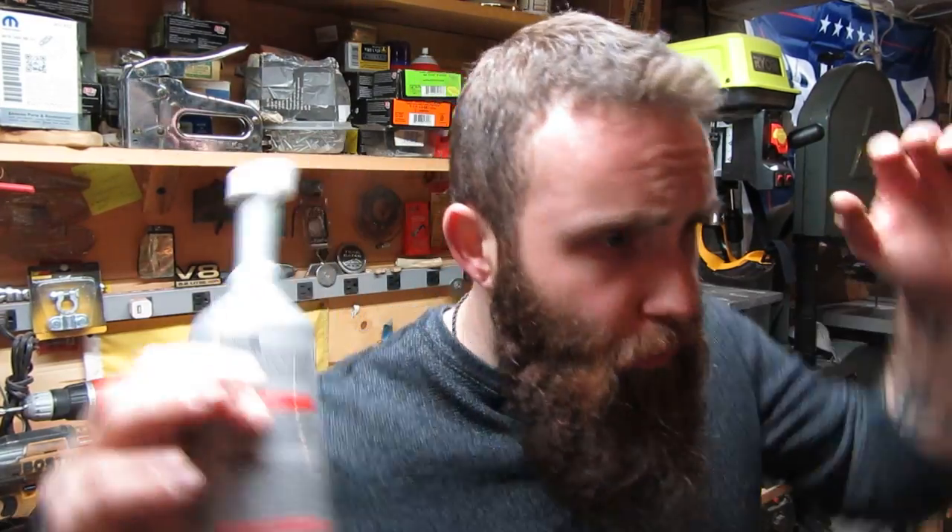If your O2 sensor has physically failed, this isn't going to help. If your catalytic converter has broken away and there's nothing left inside of it, this stuff is not going to help either. But if you are suffering from carbon buildup on your O2 sensors or inside your cat, this stuff is going to help you. Get your exhaust system nice and hot and give this stuff a chance to blow all that crap straight out your car's tailpipe. Then clear that code. If you know anything about drive cycles, you have to drive your car around a while and let your monitors get ready. I personally had my check engine light — which was on for an O2 sensor — go off for 15,000 miles using one bottle of this stuff.